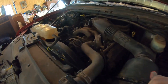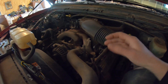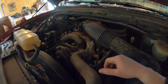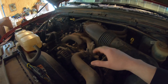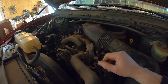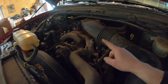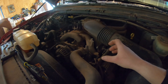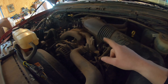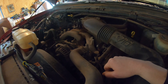The next time I go back and start it, it's got just a little bit of a miss — kind of a hesitation. These V10s aren't as easy to feel a misfire on as a V8 because you've got more cylinders contributing to the power balance. I can tell something is just slightly amiss, not a full-blown misfire, but until it warms up it's there. Could be a coil boot not sealing well with condensation that never evaporates, or a spark plug starting to get a little loose. These do have a reputation for spitting spark plugs from time to time.